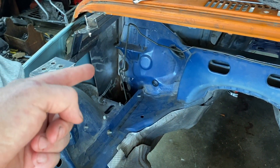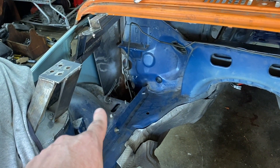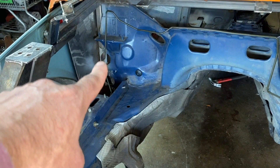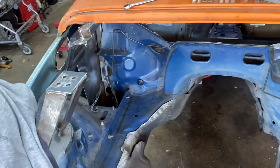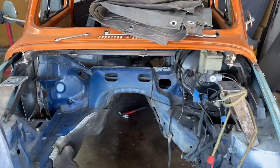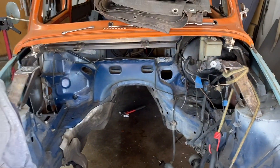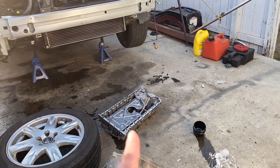There's a vertical piece there and I can't get behind it — I haven't got enough access to box that in. Boxing it in just won't work at this point. Obviously I'm going to finish all this, it'll all be welded in and seam sealed. Everything's going to be drainable but there'll still be deep crevasses. Same on the other side — things that next time I do this will be different. But it's still going to be one hell of a car. After my little operator error with the O-ring on the pan, a couple of days and we can listen to the engine again.